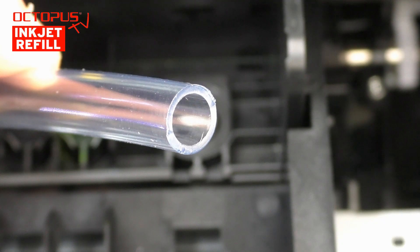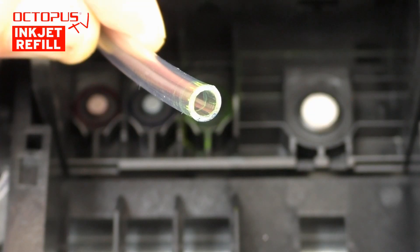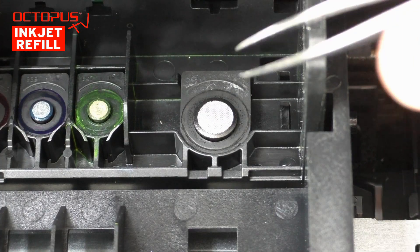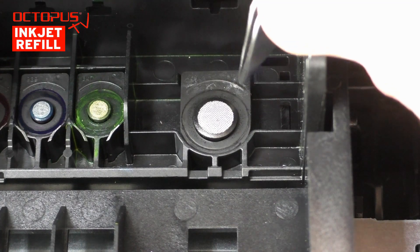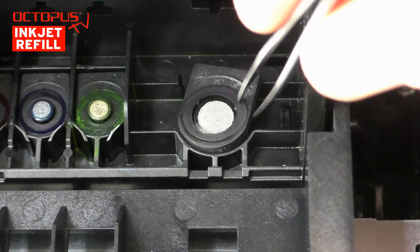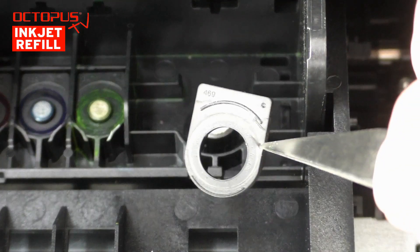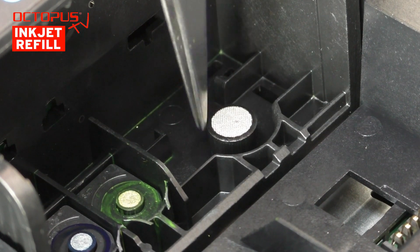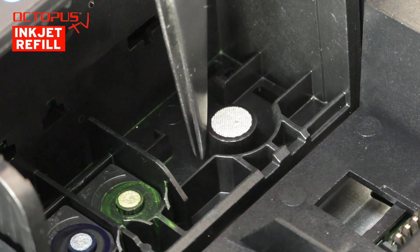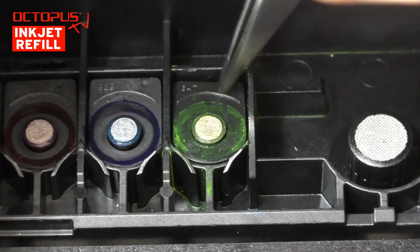For our cleaning approach we use pieces of soft plastic hose whose inner diameter matches the outer diameter of the ink ports. Around each ink port there is a rubber sealing installed. To prepare the cleaning, we take out the rubber sealing from the ink port which we are going to flush with nozzle cleaner. Here you can see that being done at the rubber sealing around the black HP903 cartridge ink port. When the sealing has been removed there is more room available on the ink port's outer rim to slide the plastic hose on.